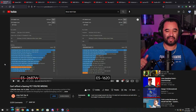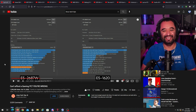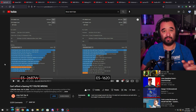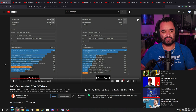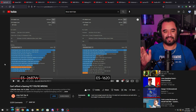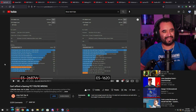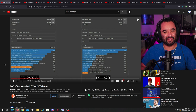The 2687W is an 8-core 16-thread CPU, which is awesome. They were doing that before mainstream platforms had it - it took AMD Ryzen until 2017 and Intel until around 2019 to bring 8-cores and 16-threads to mainstream platforms, but on the high-end platform they were doing that for a long time already. The original Sandy Bridge Xeons genuinely have lower clocks than the V2 Ivy Bridge Xeons - this is one of the reasons you want an Ivy Bridge Xeon, they're just faster for the same SKU.